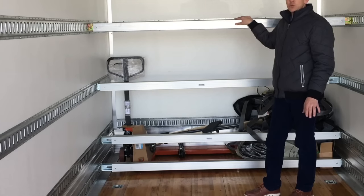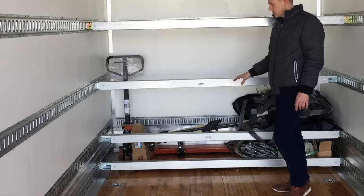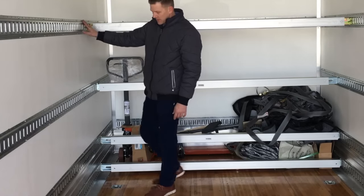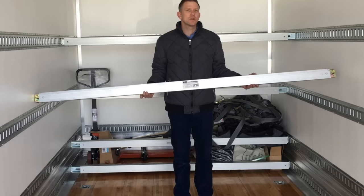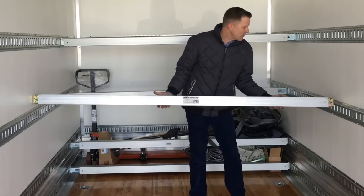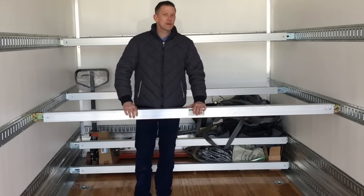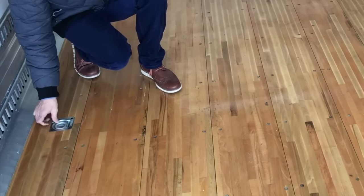The inside of this 20-foot Morgan Reefer box will come equipped with a white glove moving kit. The kit includes a pallet jack, a rolling cart, a two-stage dolly, 12 ratchet straps, 24 blankets, and comes equipped with five rows of e-track to include six load bars. To install the load bars, you'll see a sticker that says 'up' with an arrow. Point it up, come over to one of the slots until you hear it click. The inside of the box has six recessed heavy duty D-rings, three per side.